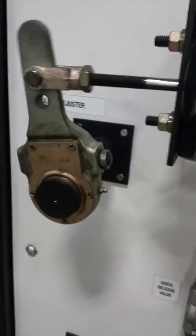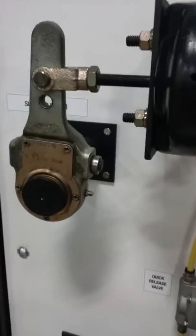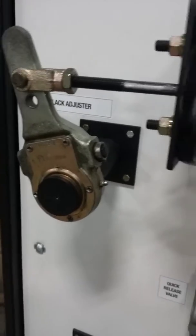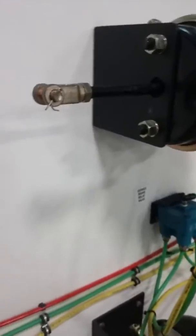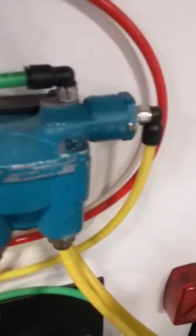Watch what it does — you see that pushes it out, and then it sucks it back in when you apply. You can see it sucks back in. On the backside, you can see the chambers get pushed out and sucked back in. Down here you can see that little side valve that runs all the way down back to your spring brake valve — and that is your relay.